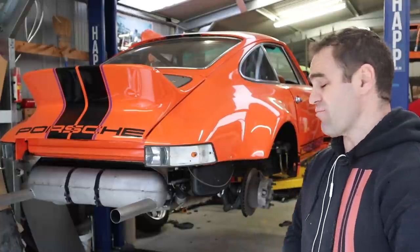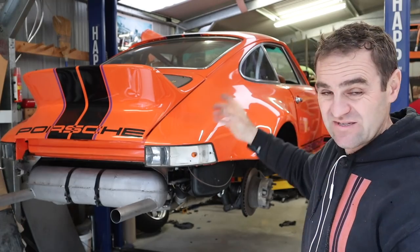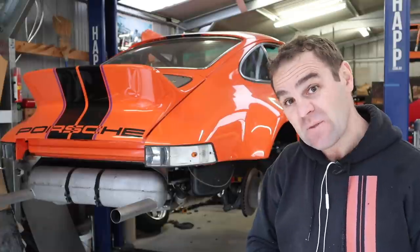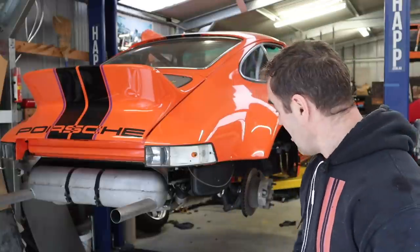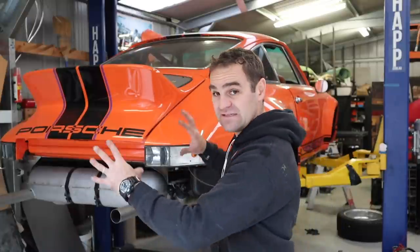I think I've got on top of most of the brake fluid leaks. I replaced the one line, gone around and nipped up a bunch of the loose fittings, and actually had one of the master cylinder reservoirs leaking at the front too — so there were leaks everywhere. I usually park Archie underneath, and brake fluid and paint do not mix well — it will eat all the way through — so I can't park a car under there for now. Next week I've still got to bleed the brakes, fit the rear bar, probably modify the exhaust, and get the whole back end put back together.